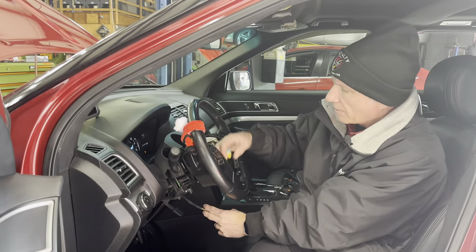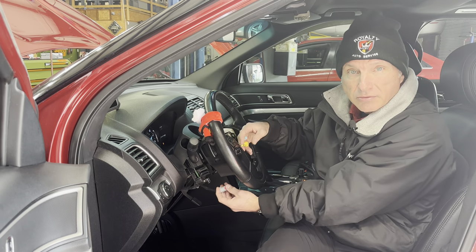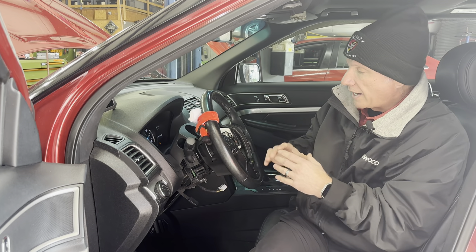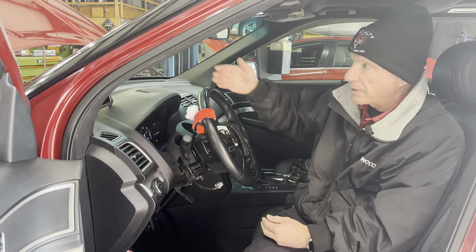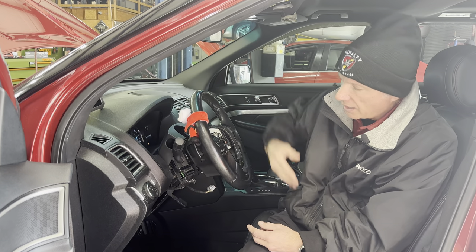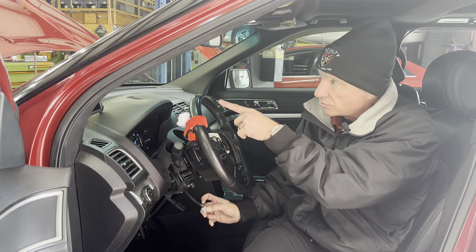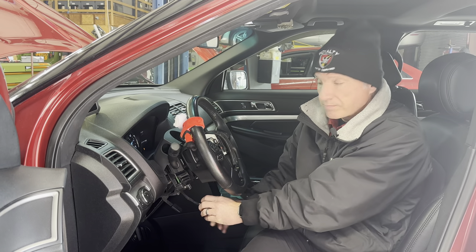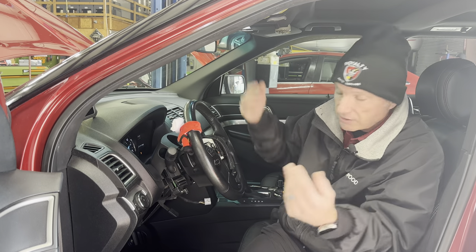So we know that above the clock spring it is not good, and below the clock spring it reads good when I put a simulated airbag into that circuit. The clock spring is the problem, and I know it's going to fix it because I'm using the airbag module itself to do the test — it's reading the resistance and looking for it to be within a certain range.